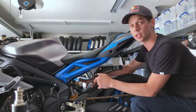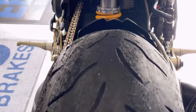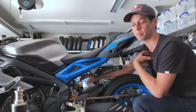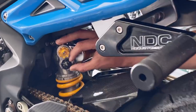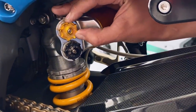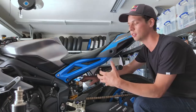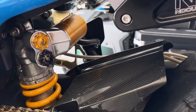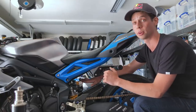As for suspension setup, I swapped out the rear shock with an Ohlins TTX and was able to get away with a revalve on the forks. For setup wise, me as a 170 pound rider, what I found the best setup was an expert level road racing settings for a 210 pound rider. Plus minus 40 pound gain on what the settings would actually be, because in certain situations when the motorcycle is under control on only one wheel, it needs a little extra support.